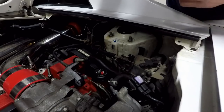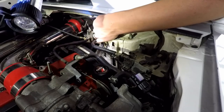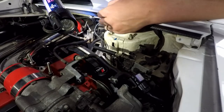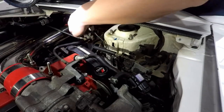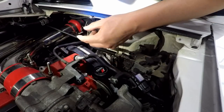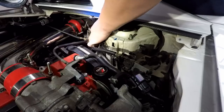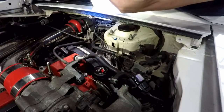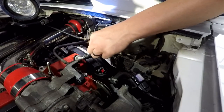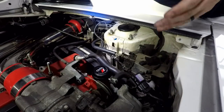There's one right down here. I went ahead and disconnected it from the mechanism in here - there's actually a little piece that almost looks like a little anvil thing. What you have to do - it's hard to explain - you need to pull back this actual lever here. Once you swing it back far enough it loosens up the actual cord because there's no tension on it. You literally take a pick and pull up on this actual metal cord and it lifts it out. Once you slide it out you're done. There's another Phillips head screw here which will loosen this up, and then we take these three bolts off and the cruise control is out. That's literally how simple this is.